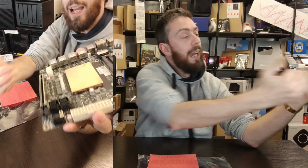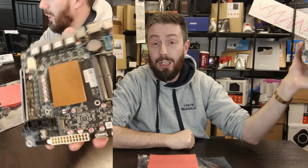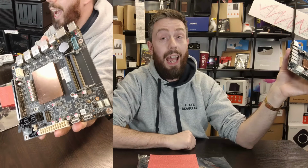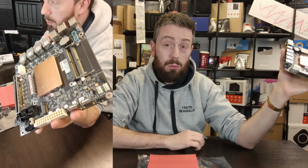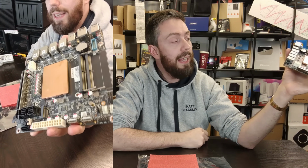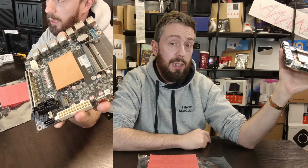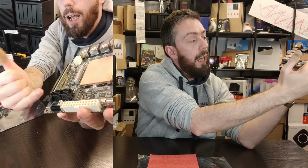Now, in terms of that PCIe connector here, you may be rejoicing that it is a times 16 slot. Well, it looks like a times 16 slot physically, but it's actually a times 8 slot, which is a bit of a pain. It's still Gen 4 times 8, which is still some lovely bandwidth and opens the door to potential bifurcation, utilizing splitter cards, that sort of thing. But still, it's nice that you've got the physical support for those cards, but I'm surprised they didn't just go with a cutout if they're just going to be utilizing it as it is.